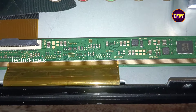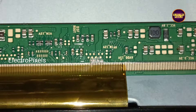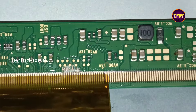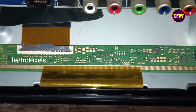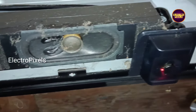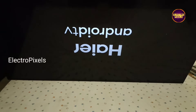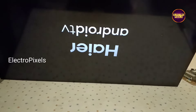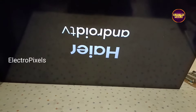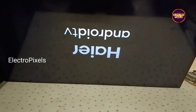These are the gate signal tracks from the right side and left side respectively. If shorting is on any one side of the glass panel we can repair it by blocking gate signals from the shorted side. If both sides are short then it's difficult to repair. This is only a temporary solution — the permanent solution is always panel replacement, and we can't predict how long the display will work using this method; it completely depends on user luck.